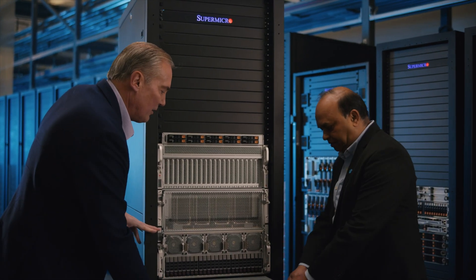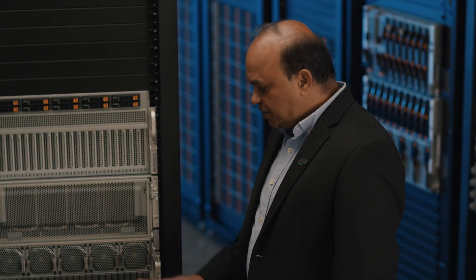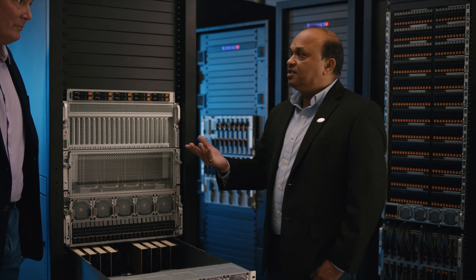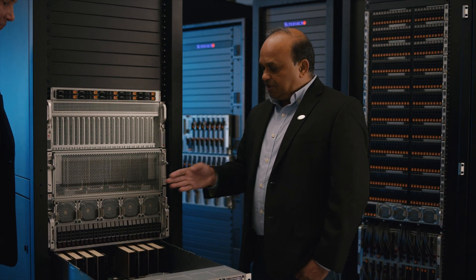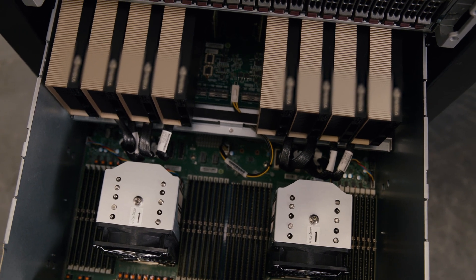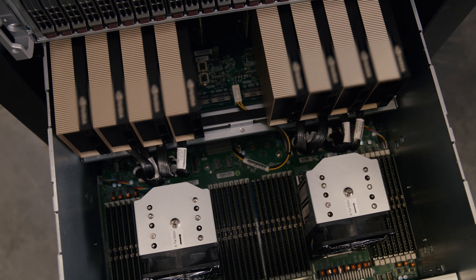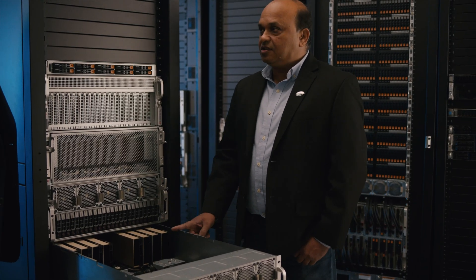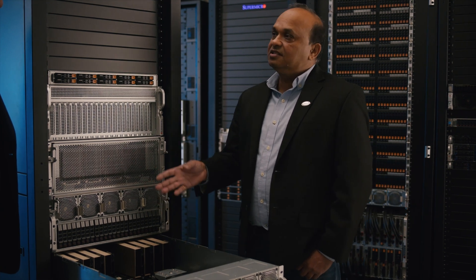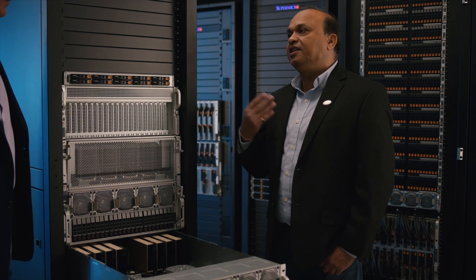Let's pull this out and take a look at the GPUs. On this system, as mentioned, there are 13 PCIe slots, all PCIe Gen 5 x16. This H100 accelerator is in PCIe form factor — the one we discussed earlier is in SXM form factor. This PCIe form factor is going to be a game changer for mainstream compute. On this particular system, you can put up to 10 H100 GPUs. Here you can see eight are installed and two slots are open. You can also use NVIDIA's CX7 networking cards that can go up to 400 gigabits per second.